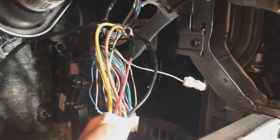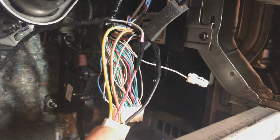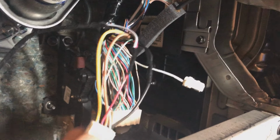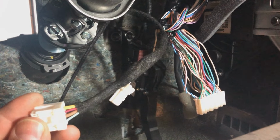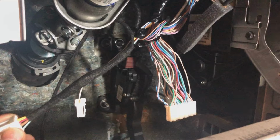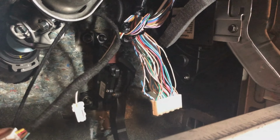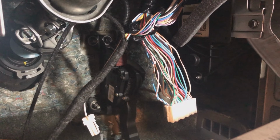So like I said, here's the trailer brake connector, and there's park lights and ground tied in there, all clean and neat, and I'll clean up that harness. And there you go. That's what a typical harness would look like after we were tied into it and finished with it. I just tied this one up next to it so that it's not flopping around. And now we'll get started on the BCM connector. Now that we're grounded and safe, it's okay to make CAN connections.